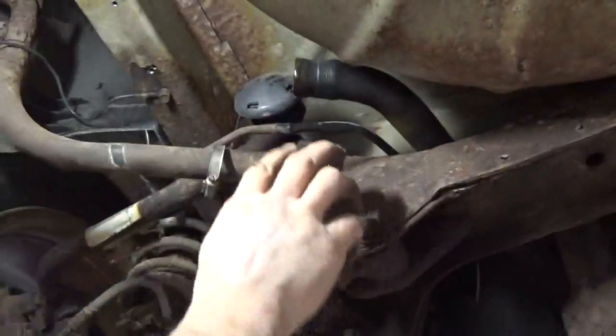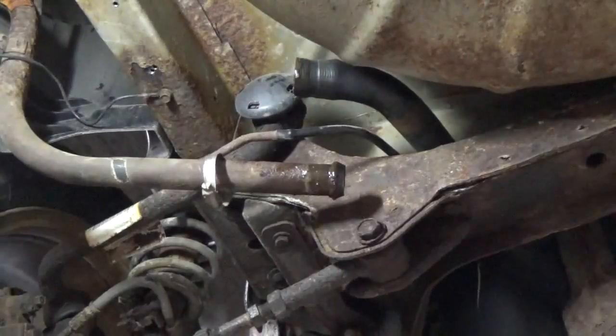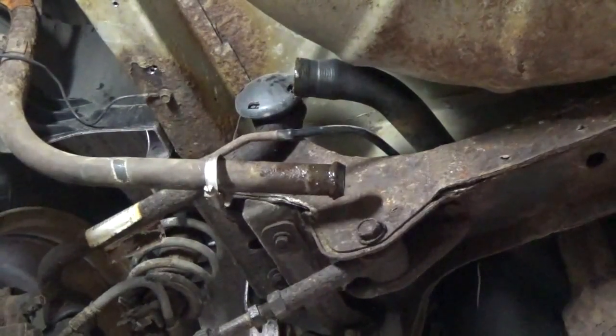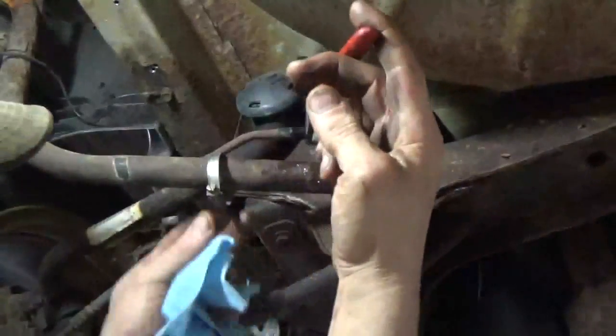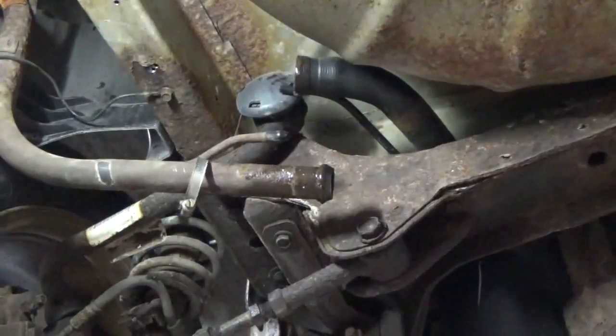See the small line going to the fuel filler neck here. I see that's a solid plastic line on this factory one. The aftermarket one just has barbs there, so I guess the only thing we can do is cut that, and we'll have to slide a piece of fuel line over it and just clamp it, which, well, we just bought the farm.